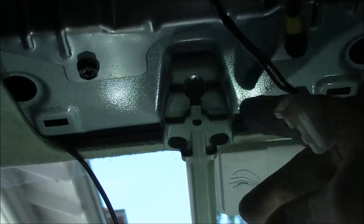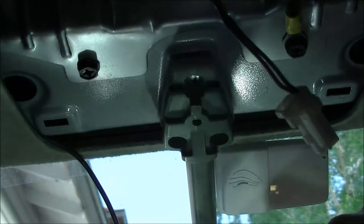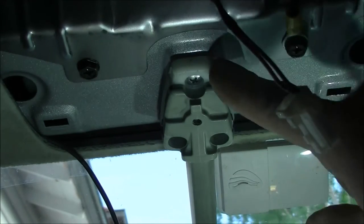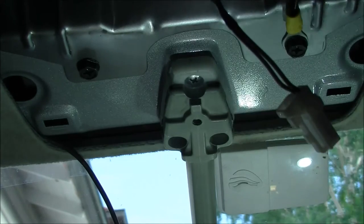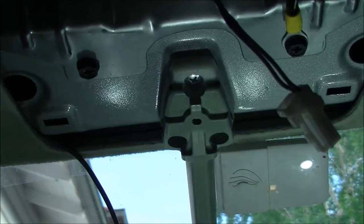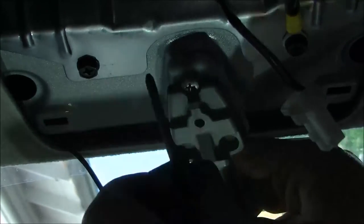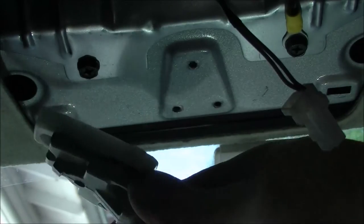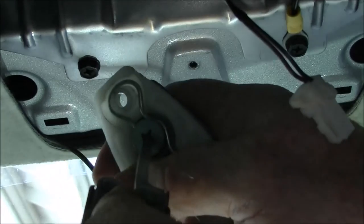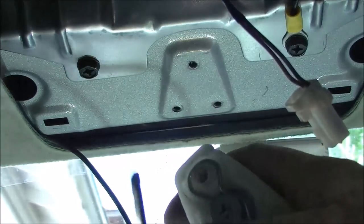Here's how the mirror is originally fitted in the GU Patrol. There's the mirror arm that goes down into the mirror itself, and there's a plastic nylon spacer that the mirror is held to. The next step is to remove the screws holding it in — there are three screws. That's the mirror removed with the plastic on the back. Then you remove that nylon piece by undoing the screw and the little spring clamp that holds it.